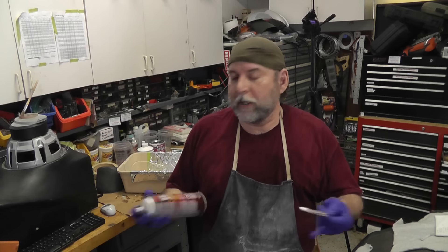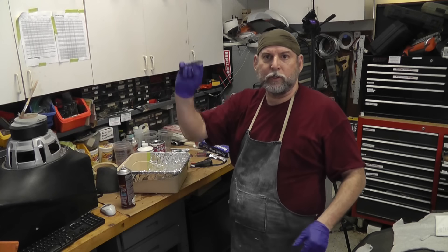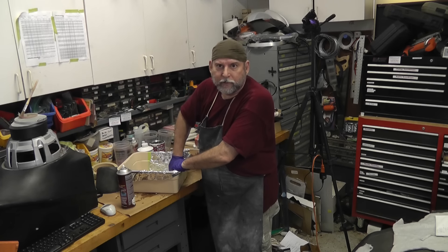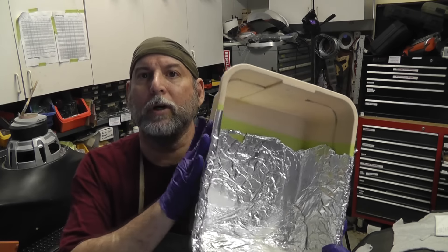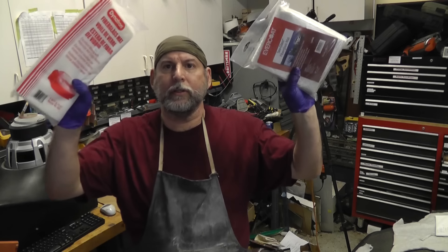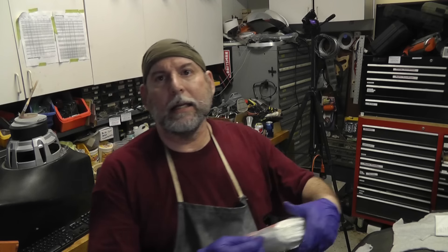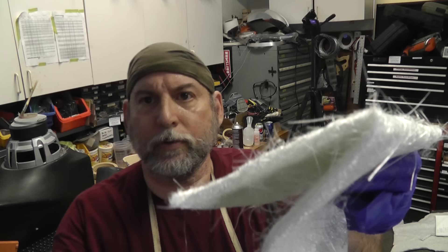You can try to make the aluminum foil flat — I always start with that as my goal and never achieve it. In complex shapes you end up having to do multiple overlaps and occasionally patching. I've left a little green so we can see our layers — the underneath is tape and then aluminum foil. Now I'm going to lay some fiberglass matting in here. Fiberglass matting comes in lots of different kinds and weights. When you go to do a freeform piece, you need a lot and you build it up a layer at a time.